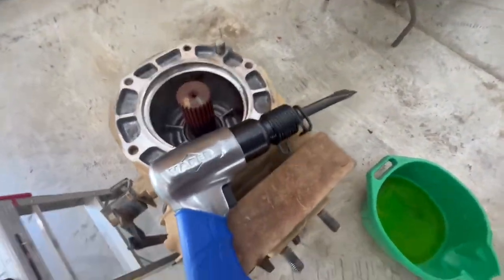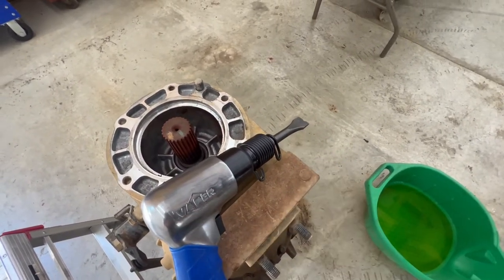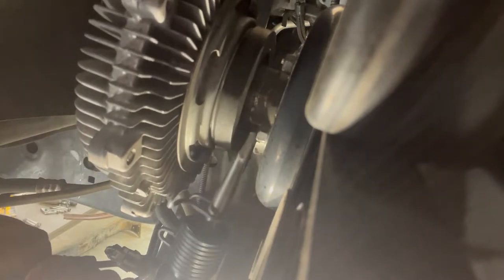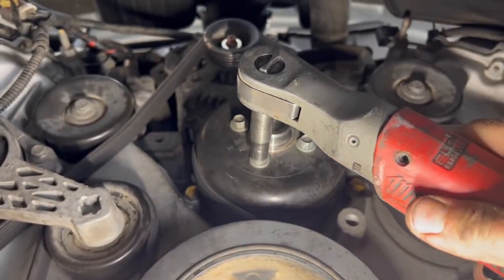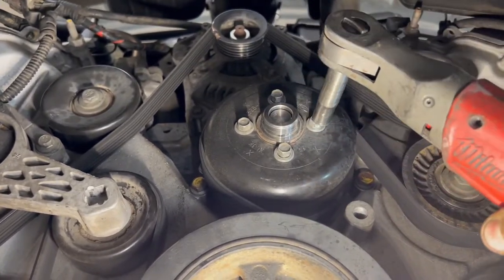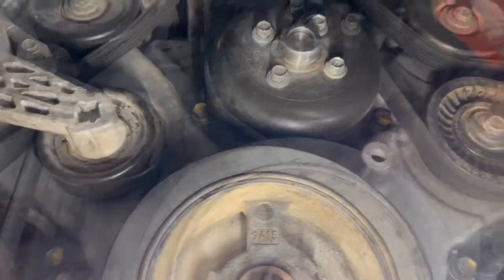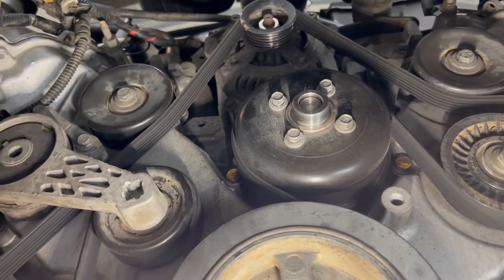This is my cheap air hammer — I use it because it's a little bit smaller to get in tight spots. Use the chisel attachment; it tears the clutch up the least amount. We're going to bust all four of these just loose right now before we take our belt loose. Now we're going to undo our tensioner right here, take our belt off, and then we'll finish removing those bolts. Then we'll be down to the water pump.